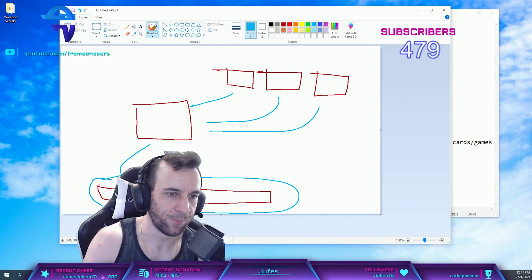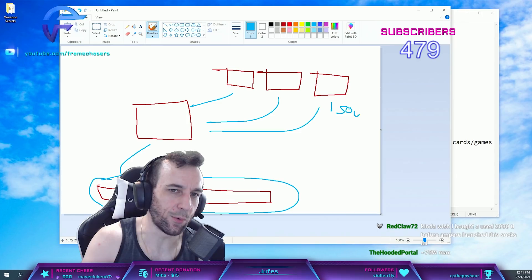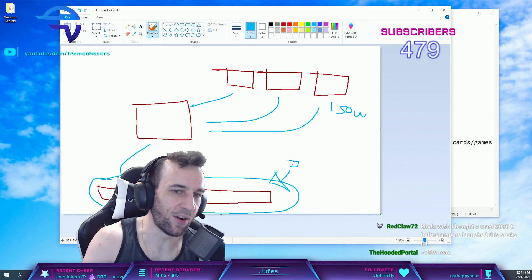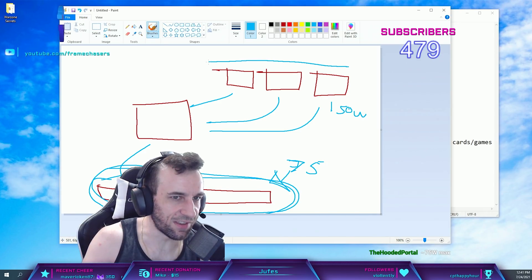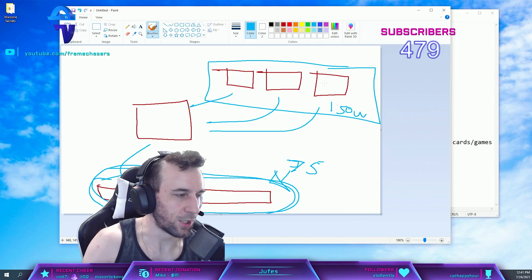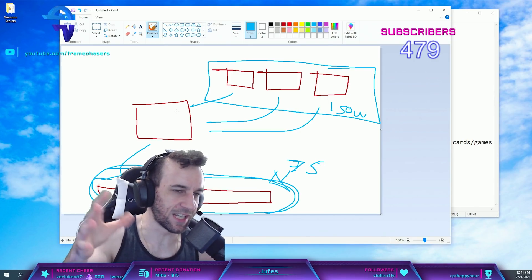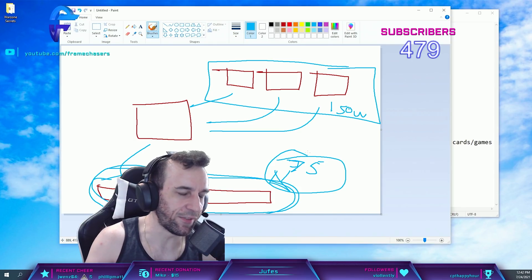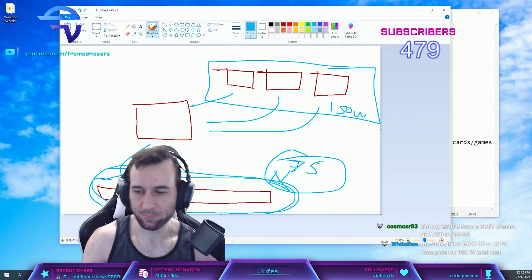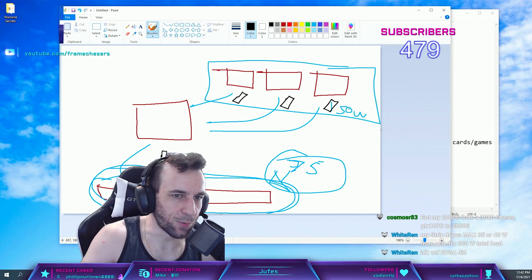This connector is supposed to pull one third, but EVGA made it pull one half. So the 8-pin connectors were supposed to pull 150 watts, but this PCIe slot was pulling 75 watts all the time. When the slot pulls 75 watts, it tells the other connectors to start pulling less to balance the load, because the BIOS is reading 75 from that slot and tells them not to pull any more power. EVGA in all their wisdom put fuses here, so if you pull too much power through them they will blow.